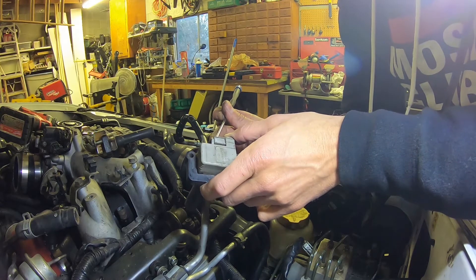I'm putting this car back together right now, and two of the four coil packs have this broken little tab, so the wiring harness is not attaching. I'm going to try a couple of different things with zip ties. The other thing I could do is replace the coil pack, but the coil pack is fine other than this little plastic tab that's not there. So I'm going to try some zip ties and see if I can get it to connect.